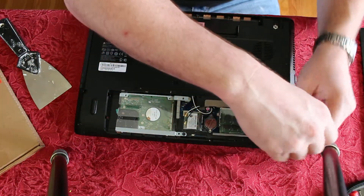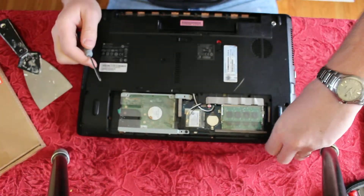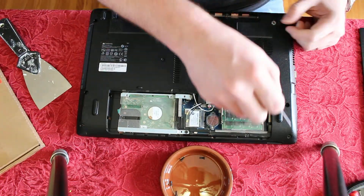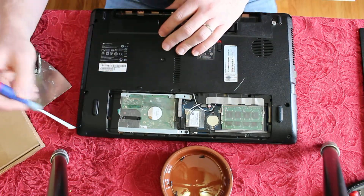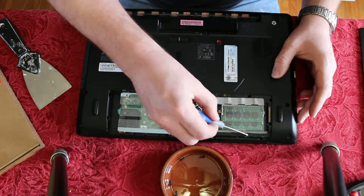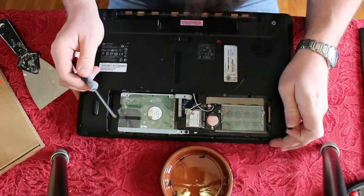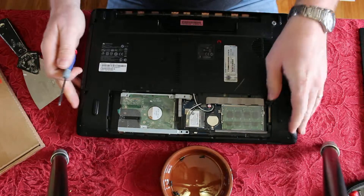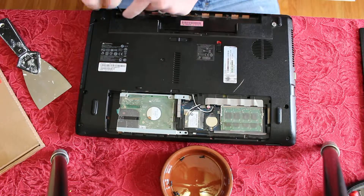It's handy to have a little dish or something to throw the screws in. So there's one, two, three, four, five, six, seven, eight, nine, ten, eleven screws, and then there's one right here behind your memory. There's another one here, and then there's four across the back — these are little tiny ones, don't drop them inside.